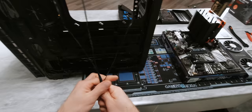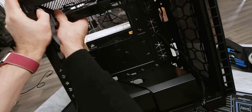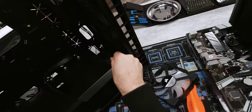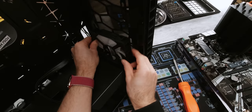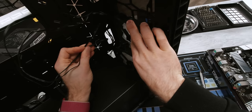Now I did say before that we were going to reposition those fans, so why don't we go ahead and do that? Now strictly speaking there was nothing wrong with our all-exhaust configuration at the top and the back with a filtered intake. But we're going to be using a pretty power hungry graphics card here, so being able to put some fresh air across it is definitely going to be an advantage — especially when you consider that modern graphics cards do get better performance when they have better cooling. So I'm going to take one of my two fans, run the cables through the bottom here, and install it as an intake fan here along the bottom. That'll cool my hard drive as well as throw some fresh air over to the power supply area. As for my second one, I'm going to put that one right here.